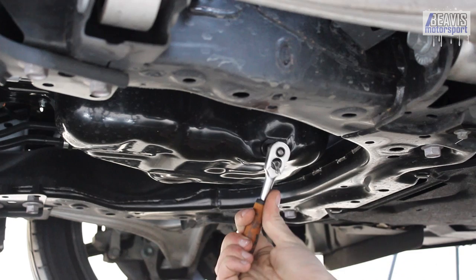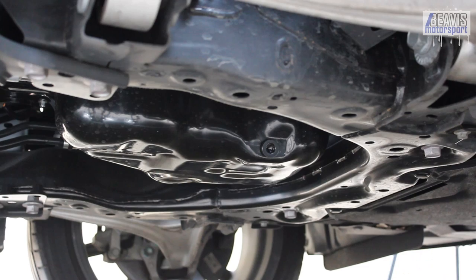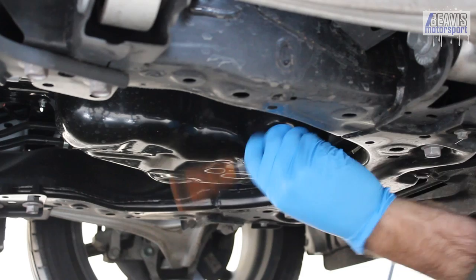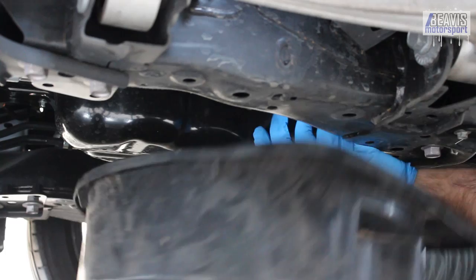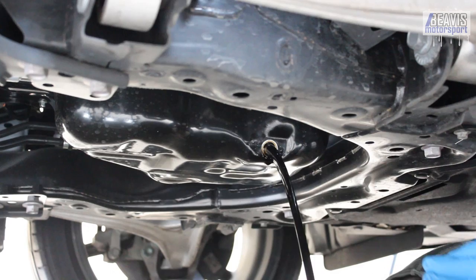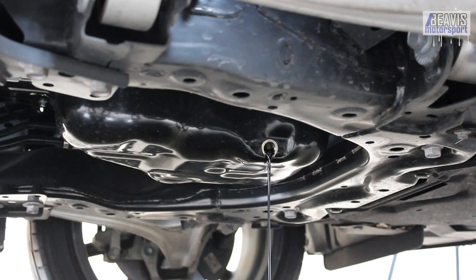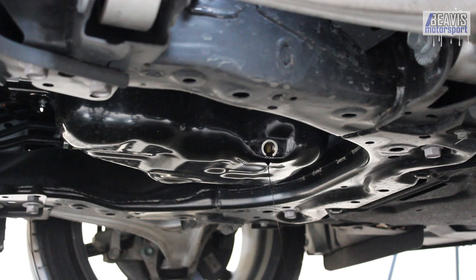Now this is the first service for our car - it's about 10,000 kilometers in and I presume it's probably still tightened up to factory specs, so I really had to get quite a bit of a lean on the drain plug to get it loose. But once it was cracked I threw my gloves on, because I don't want to get oil everywhere. I lifted the drain pan up so it can catch that first gush of oil and we got the plug out no worries. We leave that now to drain for about five minutes, and once most of it's out you throw that drain plug back on and make sure you tighten the plug up straight away.